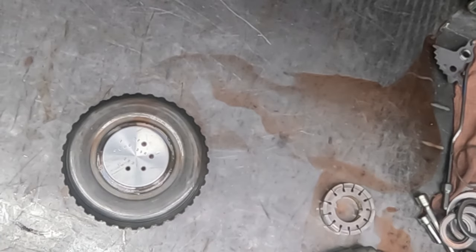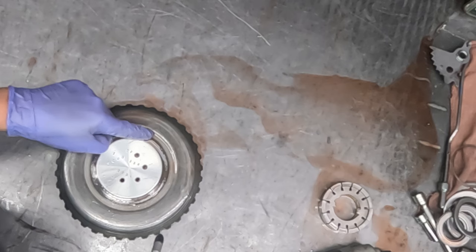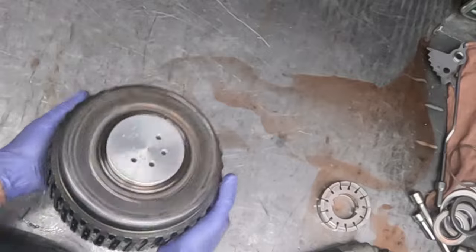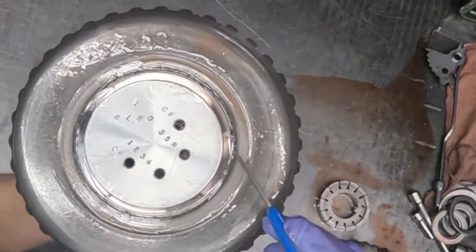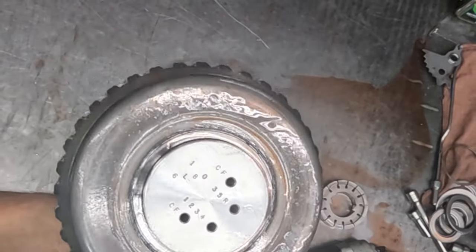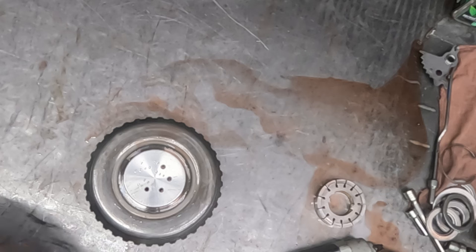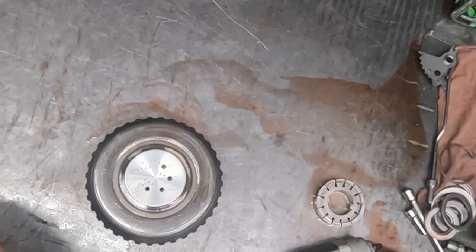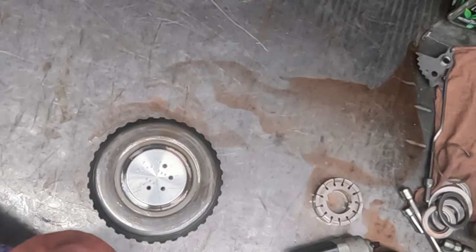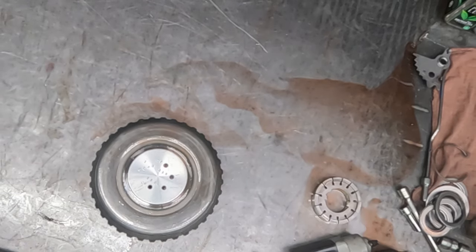What we want to check for is that the circuit seal, that there's no cracks. This is right around this area. I don't know how well the video is going to show it, but right around this area here is pretty prone to cracking. And I don't know if it's just fatigue that causes it or pressure spikes that can put a little too much stress and flex on the metal, because everything is built so light, just borderline functional.